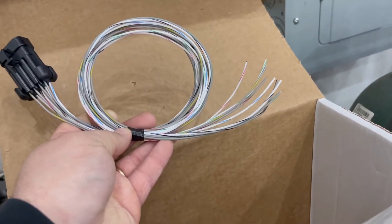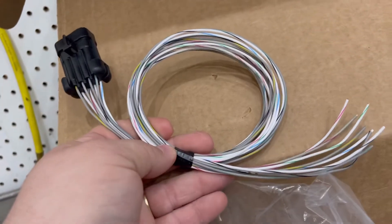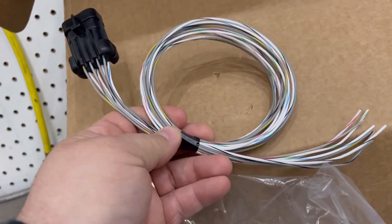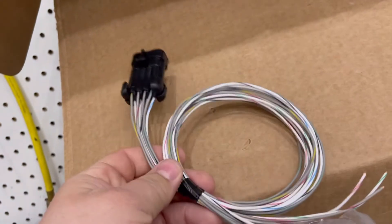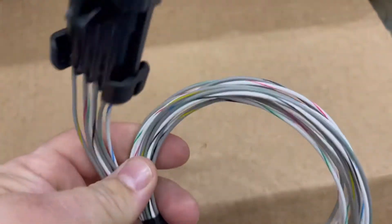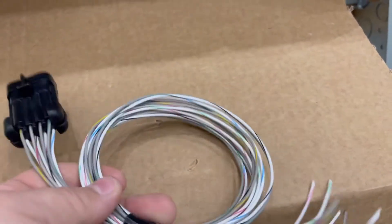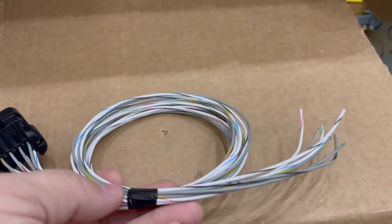I want to explain why everybody says plan ahead — plan for extra wires you don't expect, extra relays, leave yourself room — but at the same time you want it to look as neat as possible. I've counted my wires, what's coming in and out. I plan on using weatherpack connectors, which is what Holley uses. I'm going to pin everything out — the whole board, the Holley, the Leash deal — everything will have a plug and can be unplugged and removed from the truck to make it simple.